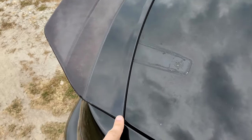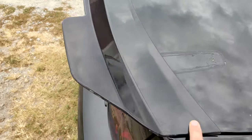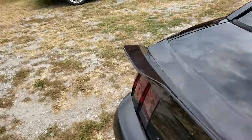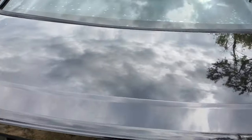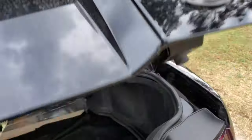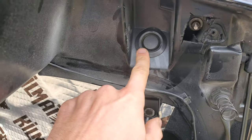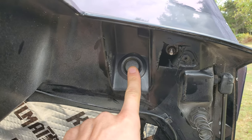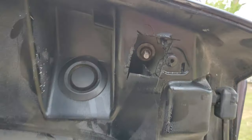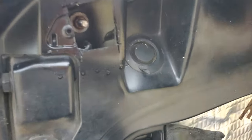You can see there's a small sunken screw area that you can't see when you look at it straight on, but other than that it worked pretty well. Of course you have to drill two new holes — I'll show you where those are. Here you can see these are the original holes for the old spoiler, and this is the new hole you have to drill. You also have to cut this out so you can get the nut on there, same thing for the other side.